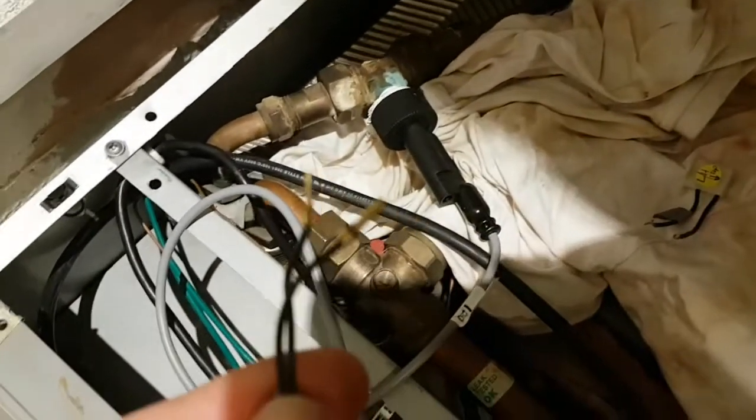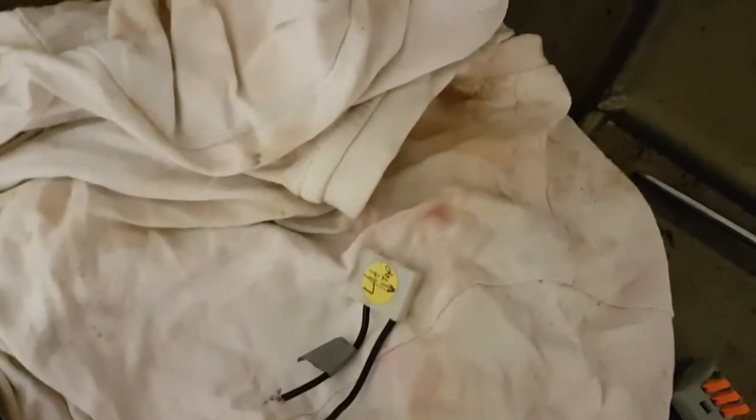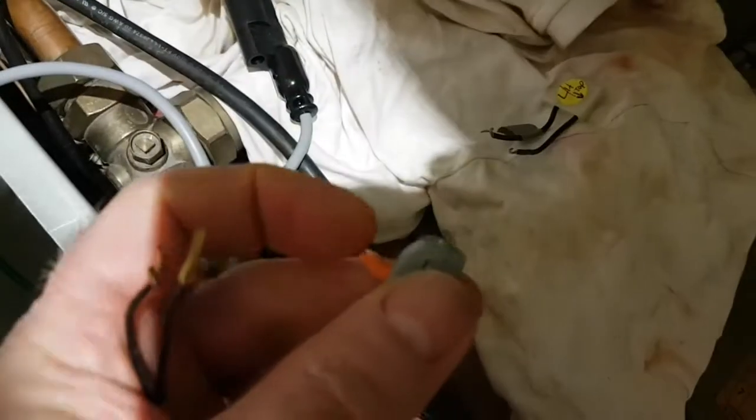Here's the PCB board — it goes there to the flow switch. I had to cut off the original connector and connect it to that, because that plugs in there. I found that on these wires there's two and a one. You put the two to the top one and the one to the bottom one. I've got to cut these connectors off, strip the wires, and I'm using one of these chock lock connectors just to connect it through. Then obviously I've got the original I can plug in to the brain.